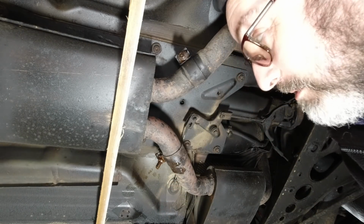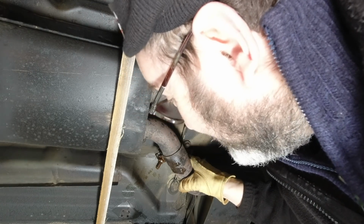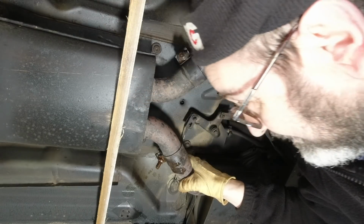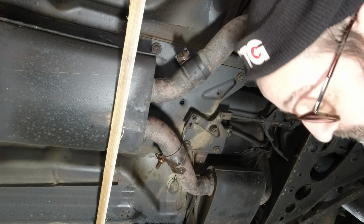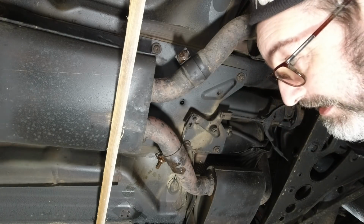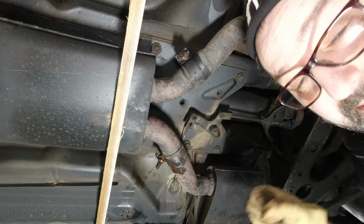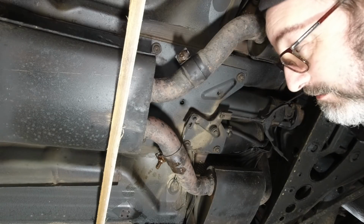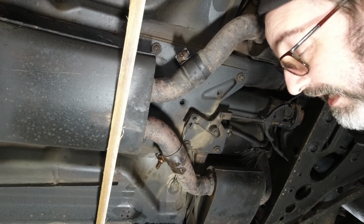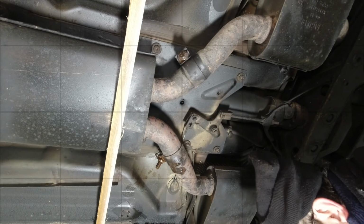Probably a good idea to put some ear defenders on. This really rings with the sound of that impact driver. Whew. I'll give it a few more minutes, give it another rattle, and then I will try a 6-sided socket and a breaker bar, which may do exactly what it says on the tin and break it, which is not a problem, before finally surrendering. We have to cut that with a disc cutter.